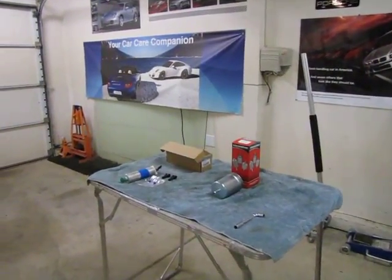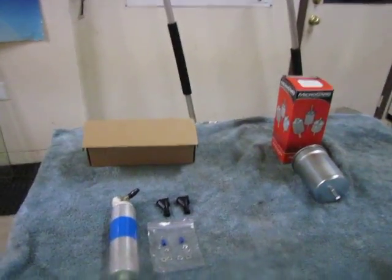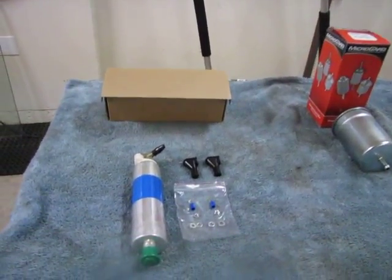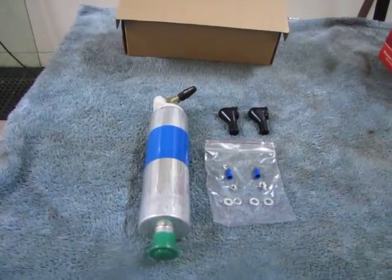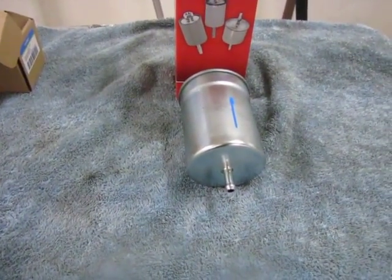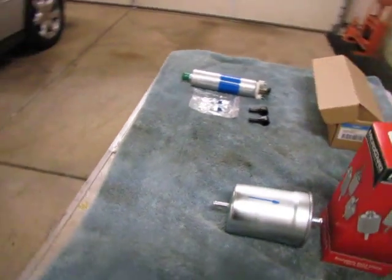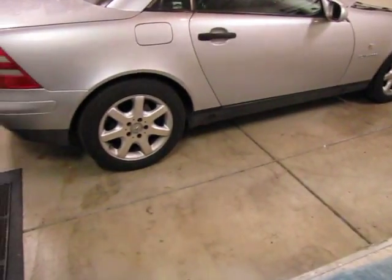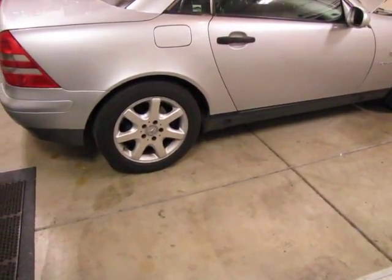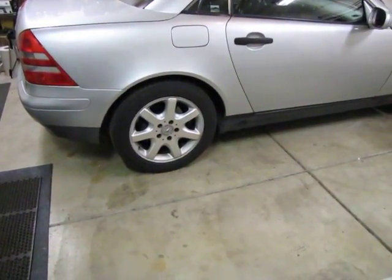Today we're going to work on a 1999 Mercedes SLK 230. I'm going to be changing the fuel pump and the fuel filter. Now to change these, you've got to jack up the car, and I'm going to take this back wheel off so I have a little bit more room to work. And there's a panel underneath you have to remove to get to the pump and the filter,